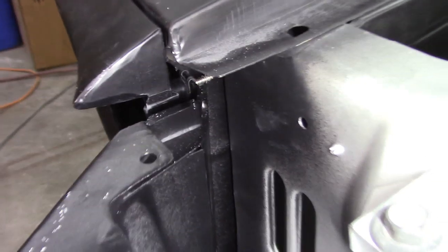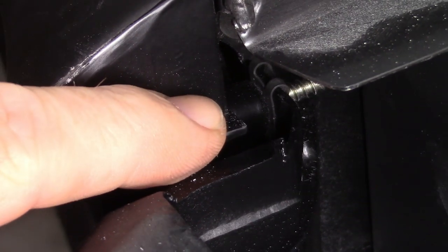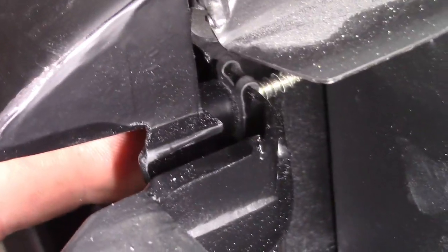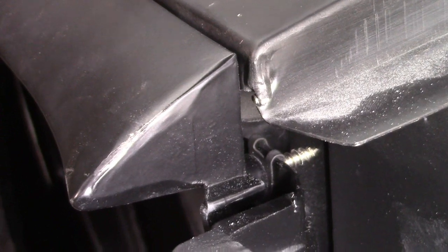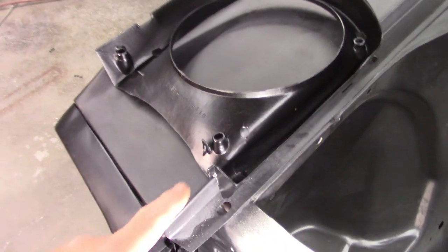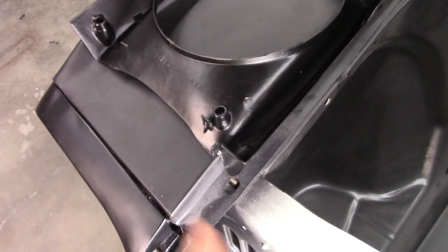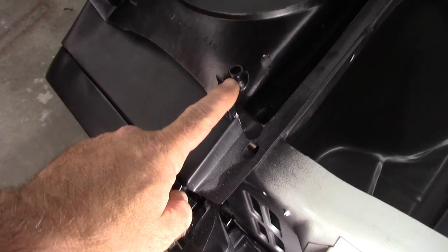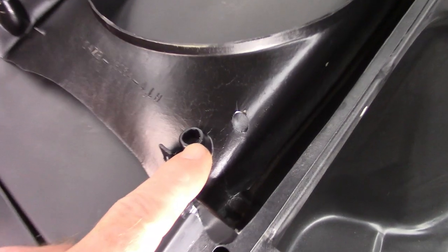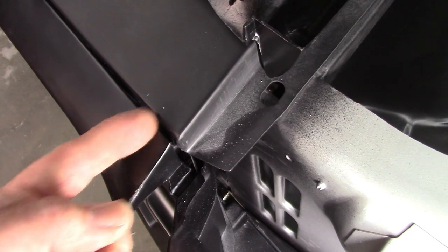And if I can show you the little standoff down here that the screw goes through, basically the backside of the extension. Let me get the other extension and show you what I'm talking about. Basically, this is the same hole. This is the top hole inboard coming from the driver's side. So basically, I can take this standoff, as that would be called, and grind that down a little bit, and that's going to allow this to go in.